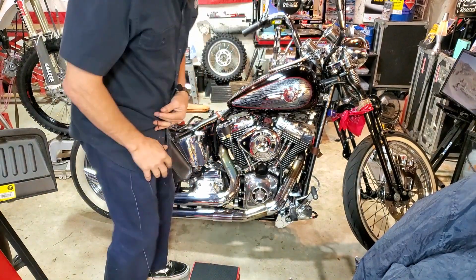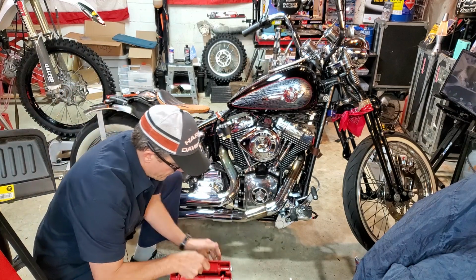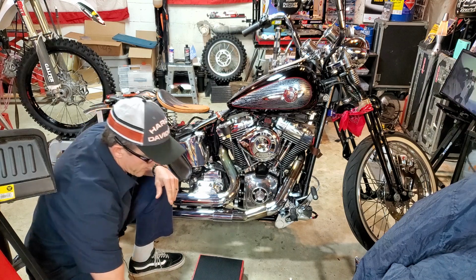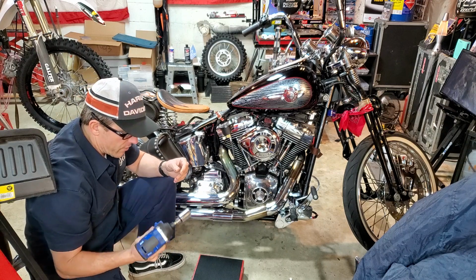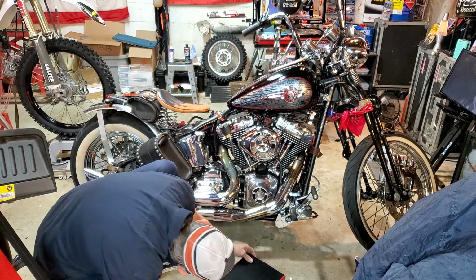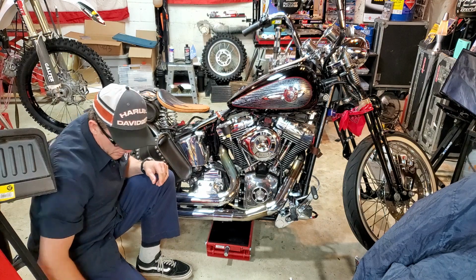All right, behold the low profile jack. It's a screw jack. It's pretty heavy. It's not a little cheapy thing. You could use a regular wrench, but honestly, put a 21 millimeter socket on your drill or your impact. And yeah, it works so easy. Just make sure you get it around the center of your frame there, or wherever the balance point is on your bike.